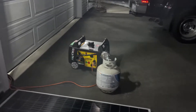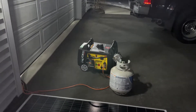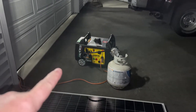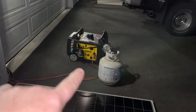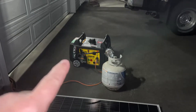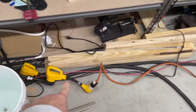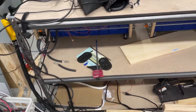One last question I had for my system was: will it run off of a generator and do everything I needed to do? If I'm out boondocking and need to use a generator for some reason, will a relatively small generator like this work? This puts out about 2,800-2,900 watts of power on propane, and I've currently got it plugged into a 15 amp receptacle. The generator comes in here and goes through a standard RV dog bone adapter, converts it to 50 amp, and goes into my Victron setup.